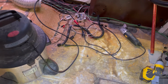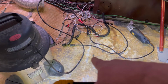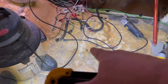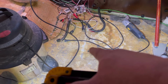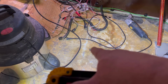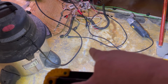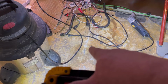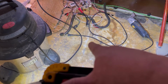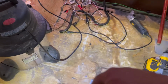That was fun getting that out. Because that bolt hole right there was on the other side of my air tank down in the tool compartment. So I had to get a really long handle 3/4 inch wrench on the end of that. I could just barely see, do by feel, get it on the nut there, unscrew that with the wife turning it from the top, and yeah, putting it back in ain't gonna happen like that. The tank's probably gonna have to come out in order to get to that bolt if it ends up being in the same spot.